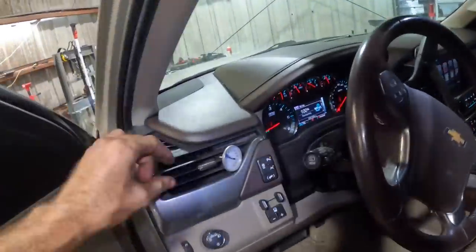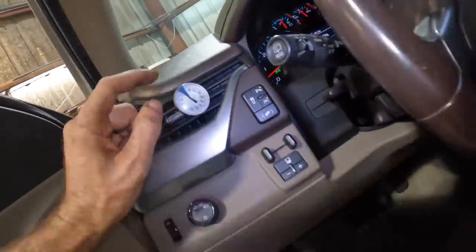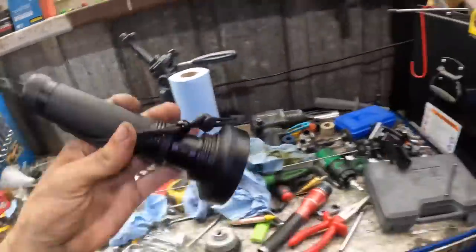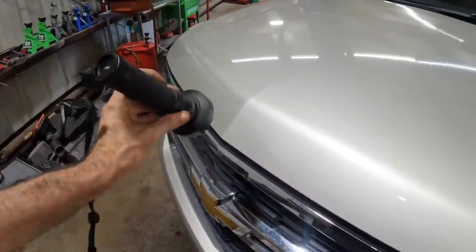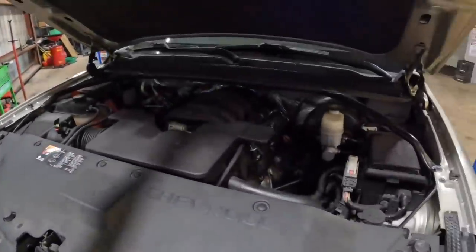Okay, so during the intro break, I had this thing running again, and it's still making cold, which tells me that if there is a leak, it's fairly small. Let us pop an easy hood and see if we can detect the presence of said leak. I have here my ultraviolet blacklight LED emitter. It's not as bright as it looks on camera, but it's pretty bright. It should show us any presence of the ultraviolet reactive dye.